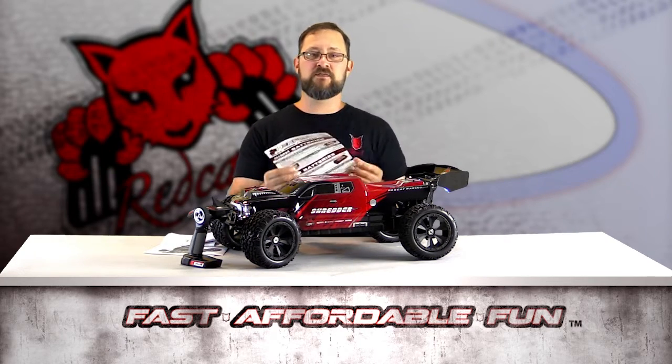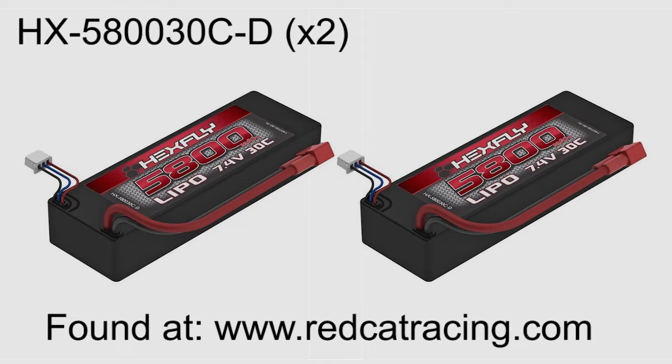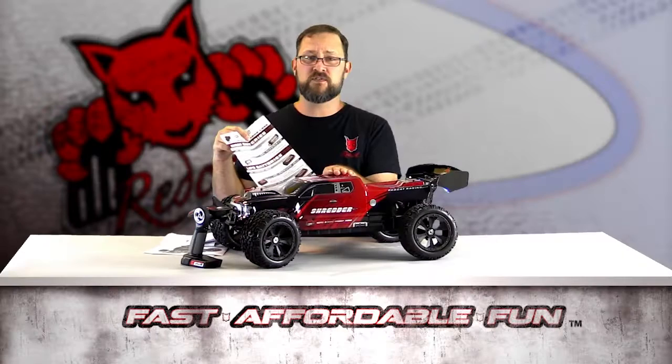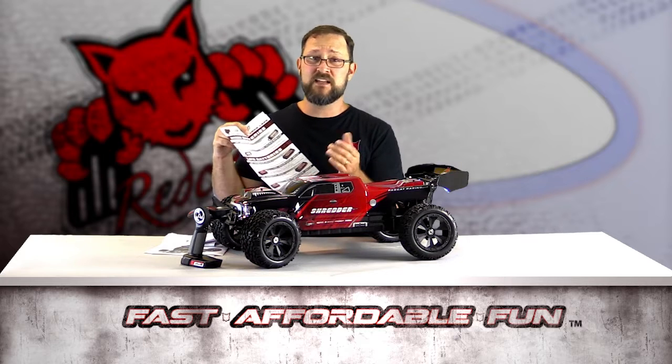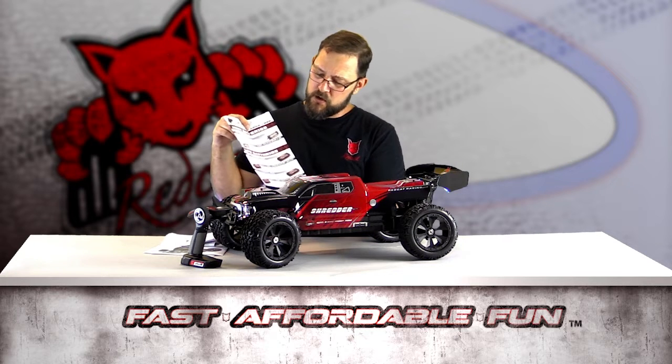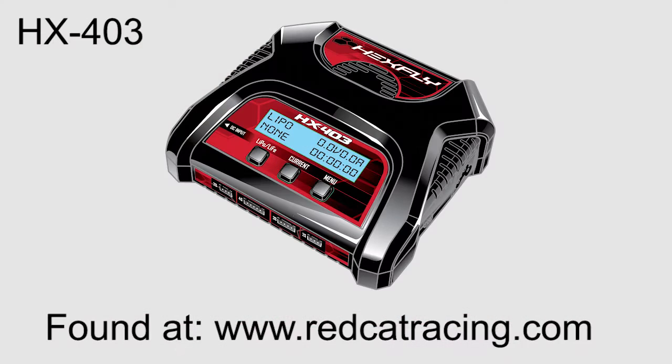We also have a Hexfly flyer here. I recommend the HX 5800 milliamp hour 30C 2S LiPo battery pack for this vehicle with T-style connectors, or some people will know them as Dean's style connectors. Okay, so we recommend 2 of those 2S LiPo battery packs for this vehicle. And for the charger, we recommend the HX403 LiPo battery charger.